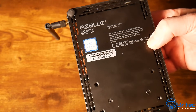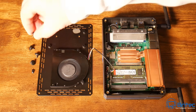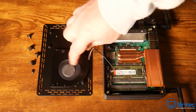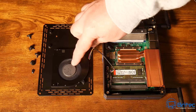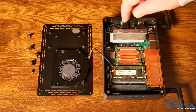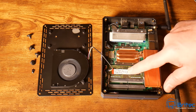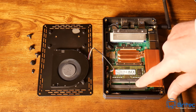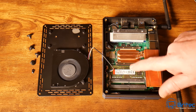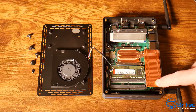The device is plastic on top and metal on the bottom, with a VESA mount point — though that doesn't come included. Taking it apart, you can see a fan inside and screws for the rubber feet. Removing two more screws gives access so you can replace or clean the fan. There doesn't appear to be room to mount any additional drive inside. It came with only 4GB of RAM on a single stick, meaning it runs in single-channel mode, which will impact performance.